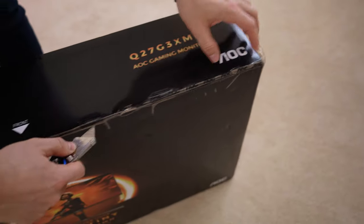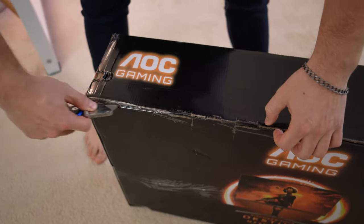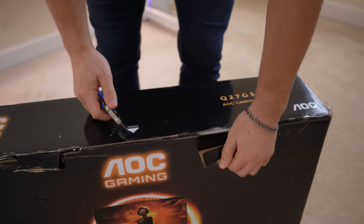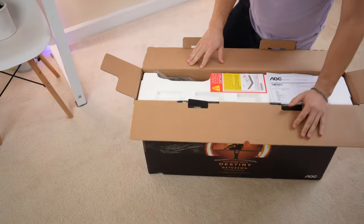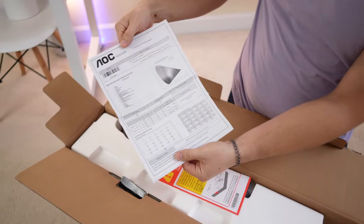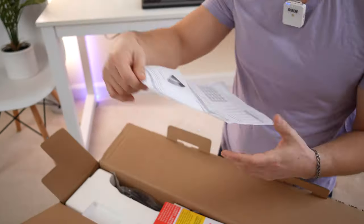This is mini LED lit, it's like $270 to $280. The way they get it so inexpensive is that it still is legitimately mini LED lit with around 300 something zones — that's full array local dimming — but they use a VA panel. That's how they get this much cheaper. They even include a color calibration report in a $280 monitor, which is very impressive. That'll be interesting to test in the full review.